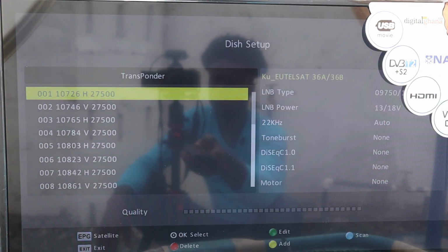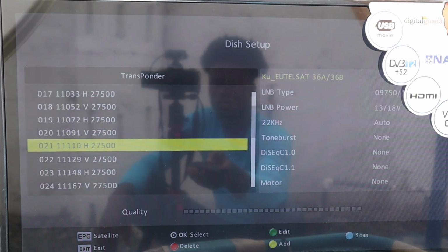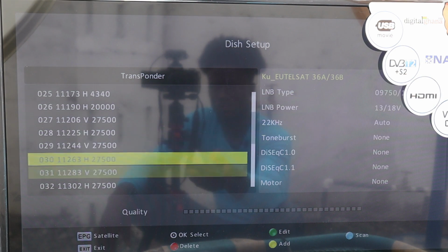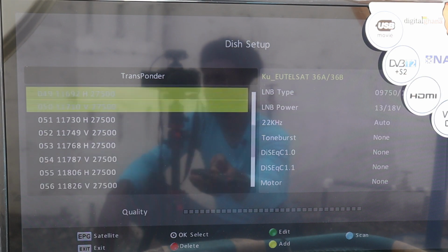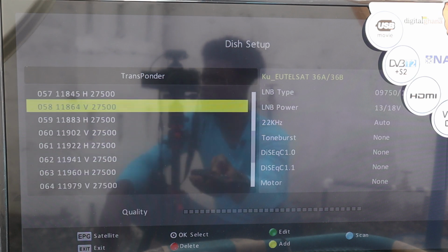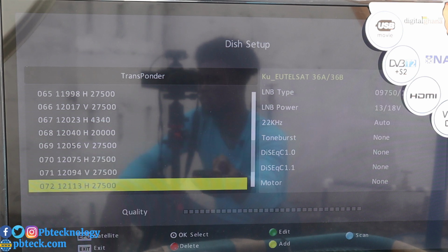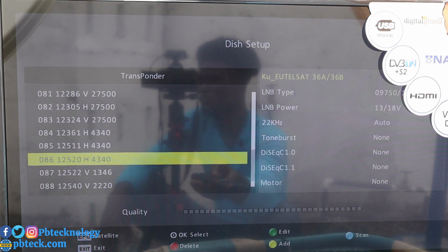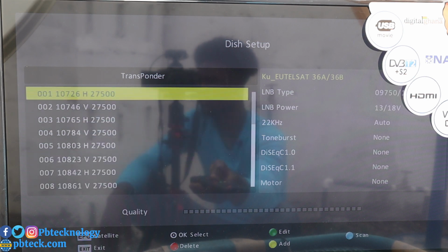Right here you need to search in the list whether you have the unique DSTV frequency that you can use to track, which is 12245, horizontal, 27500. If you can't find it, you can use a different one as well, but using this TP helps you get a signal very fast. I think it's not in the list, so here you have to add.